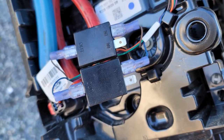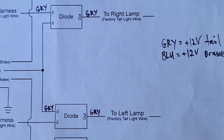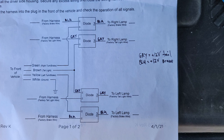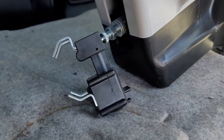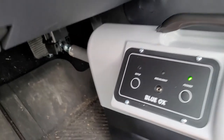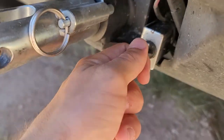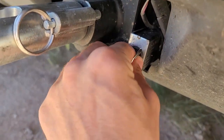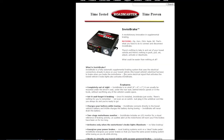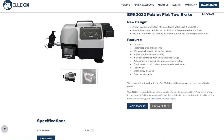You'll need a flat-tow wiring kit. This kit will make sure that the rear lights on your Bronco copy whatever the rear lights on your tow vehicle are doing — things like brake lights, turn signals, and hazard lights. You will also need some form of brake assist. These are devices that actuate the brakes on your Bronco when you press the brakes in your tow vehicle, which can help reduce braking distance. This will also include an emergency brake-away switch — basically a grenade pin — that will make the Bronco slam on its brakes in the event it gets completely detached from your tow vehicle. Most states require this. Some get physically plumbed into your Bronco's braking system and are activated by wire, while others physically press on the brake pedal when the device detects a braking event, likely through an accelerometer.